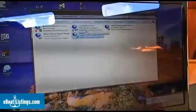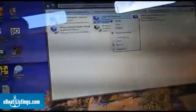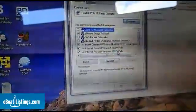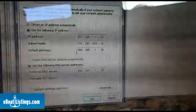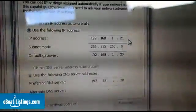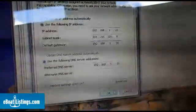This will be different depending on your operating system, so find your network connections. Then we're going to enable your local area connection — right click and go to Properties. We're going to enable TCP/IP version 4, double click on that. Then we're going to set our IP address in the same block as the IP address of the bullet. The IP address of the bullet should be under Default Gateway — it's 192.168.1.20. We're going to set ours in the same block but not the exact same IP address so that we don't have a conflict. Ours will be 192.168.1.21. And the preferred DNS server we're going to set as the IP address of the bullet, 192.168.1.20. Say OK twice.